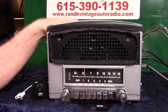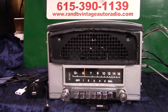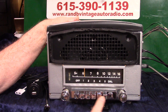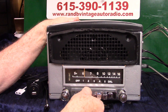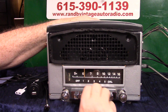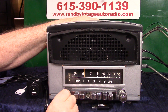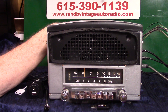It's got built-in balance, built-in fader, and tone control — which is the new stuff. It's push-button operated, which is real cool, because on some of these when you get the bezel on them they're hard to get to. Back in AM radio all you had was tone. These five here are all presets with individual coils. So say we want to set one up — pull the button off, there's a little screw that runs its own individual coil. Got it set, put the button back on, and you can set them all up this way.